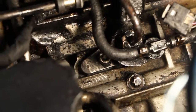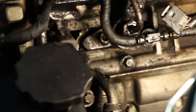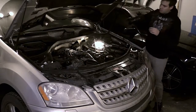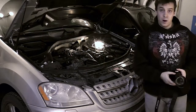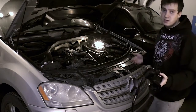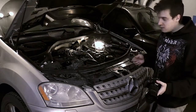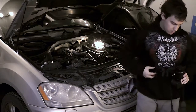Now what I'm going to have to do next is rather simple - I have to put everything back together temporarily, because in order to remove the fuel injector you have to have the engine warm. That's the basic recommendation everyone's going to tell you: if you're going to remove the fuel injector, do it while it's hot. That way it usually comes out easier, the bolt gives you less problems, the whole injector might give you less problems. However, we're going to do one more step to help it move.